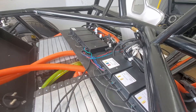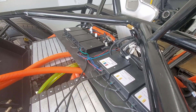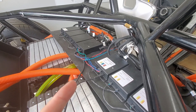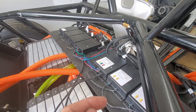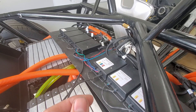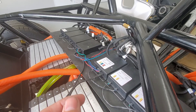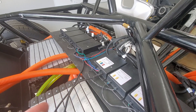Just testing out the BMS systems again. Before, I had one that was just red and green flashing and the other one was green. It turned out that the thermistor plug — I don't know if it wasn't seated or if there's a slightly loose wire, but when I plug that in all the way it's working now. So good news.